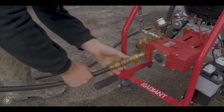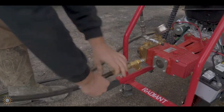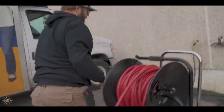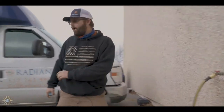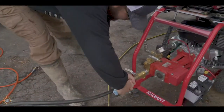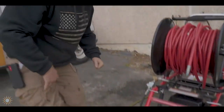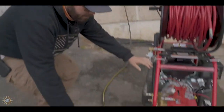Once you've sufficiently purged the line, cut it and turn it off, then retract your hose and connect it to the front of the actual machine. Make sure it's got a gasket in there, or you're going to make a mess. Tighten it down - you can use channel locks if you need to, though normally you don't have to. Now that it's hooked up and purged, we've got water only coming to this ball valve.